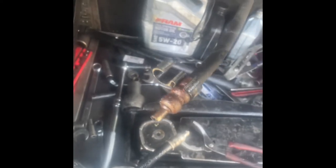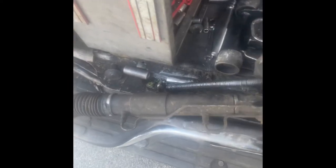One thing I'm going to tell y'all now - these hoses right here, if your hoses look anything like these, I'm telling you now, you are going to need to replace both of them. One of them I'm going to fabricate using some high pressure vacuum line or something like that, but this one has to be ordered. It literally broke as I was taking the fitting off, so I got to go order that one from the dealer. If your hoses look corroded or chewed up like that, you need to replace them.